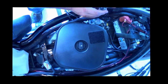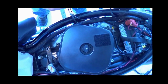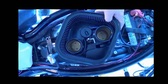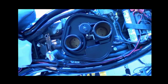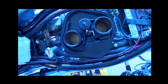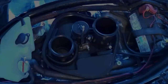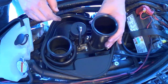I have to remove this sensor's clip, move that out of the way, remove the top of the air box and the air filter. As you can see down in here you've got your intake air assemblies, and what we'll need is the 5mm wrench to remove the 6 bolts that you can see all the way around the inside. I've loosened the 5mm bolts, all 6, so that these are now removable.